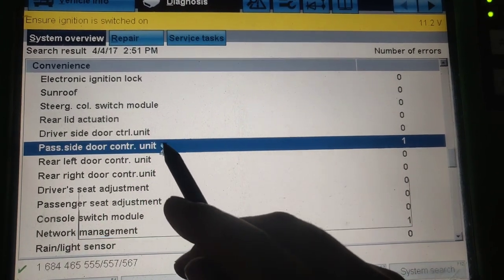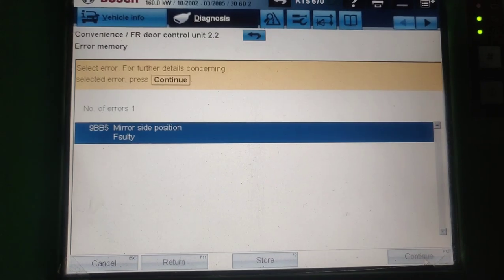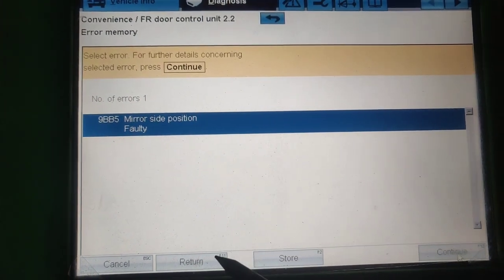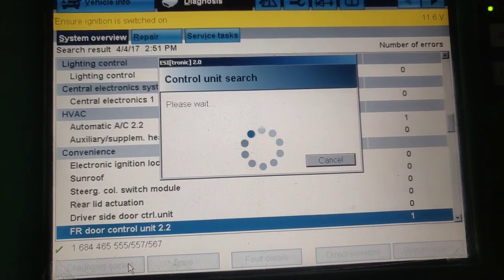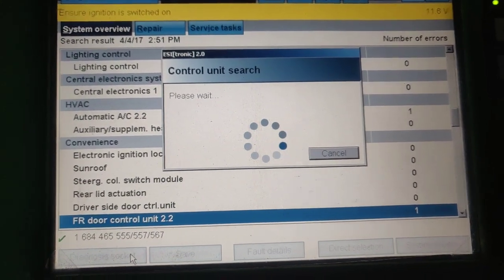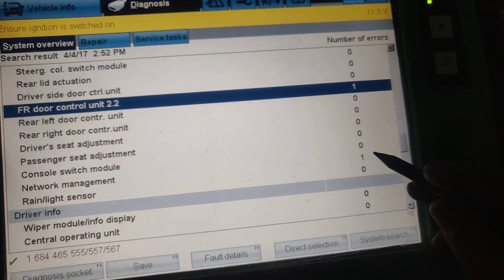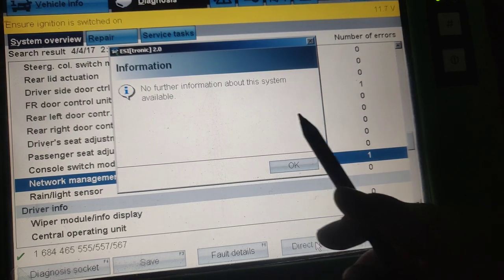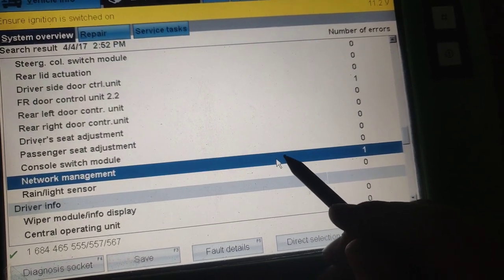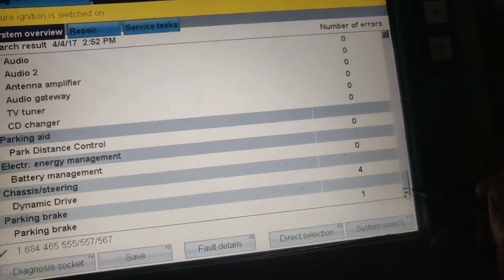This is the auxiliary heater — we don't need to worry about that. The front passenger door has a fault for the mirror side position, but that's not a big deal. The important thing is that all faults link to the ABS/ESP stability system. It's very important to understand how many faults in which ECUs, because the ABS/ESP system communicates with most systems. In this case the network system is not accessible.